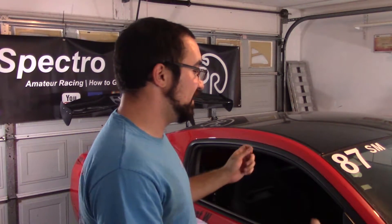What's next is putting a clutch and flywheel on this car so we can supercharge it — that should be a ton of fun. Adding the nice suspension brought some drivability back to it, but the clutch and flywheel is going to remove some drivability because it's going to be a higher engagement speed, lighter flywheel, and stiffer clutch. Once the clutch and flywheel are done, I'm also dropping in a very expensive MGW shifter.